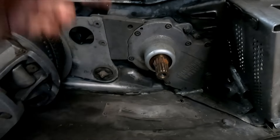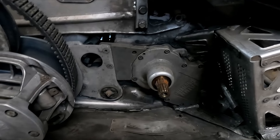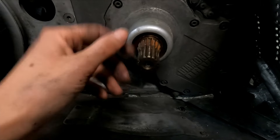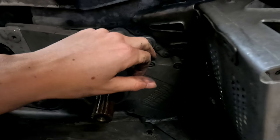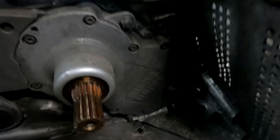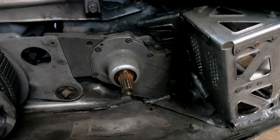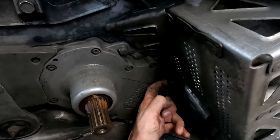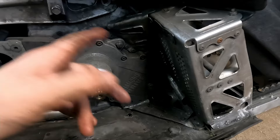Here is our diamond drive - we need to pull this off. I think I take the nut off on the other side at the brake and then the whole thing should come off. Everything here looks good - this bearing looks nice and tight, a little bit of backlash which is normal, and there's a pretty new gasket here. Also my speed sensor isn't working because my speedometer's not working. I think this is it right here - maybe it just has a cut wire. Hopefully, if not, I'll need a whole new speed sensor.